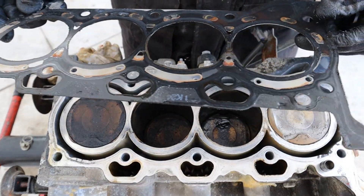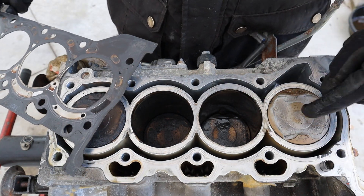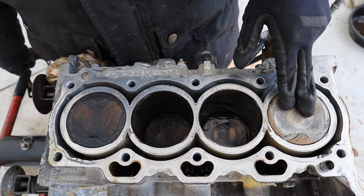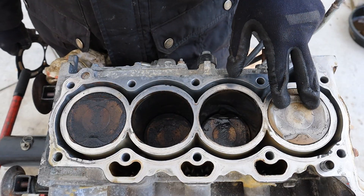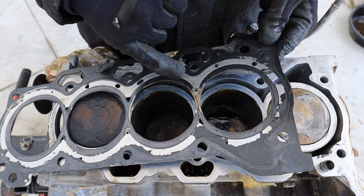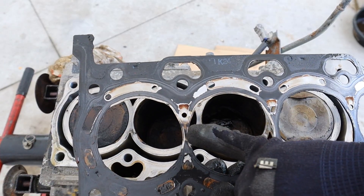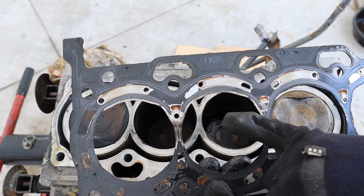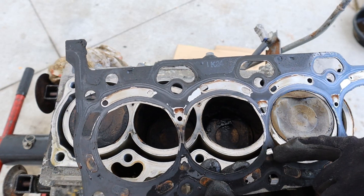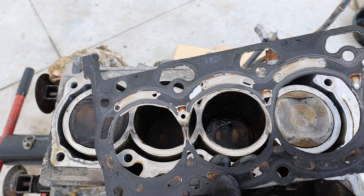After a little bit of encouraging, I got it to pop free. I'm going to take off the gasket here, and I can already see that this was the piston where it was leaking into. Basically all the coolant from around here is leaking into the cylinder. If you compare that to the other three, this one is sparkling clean — that's not normal for an engine with 290,000 kilometers. That's because it was burning coolant, which was basically steam cleaning that piston. Sometimes it takes a tiny little failure point between the coolant jacket for some coolant to leak inside, and then you start burning coolant and eventually losing compression. You can see there are slight burn marks between these two cylinders, indicating loss of compression.